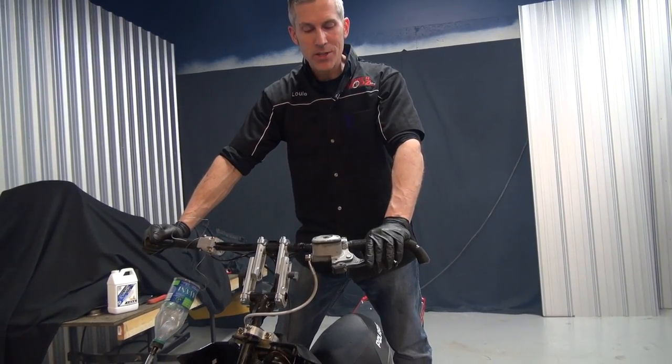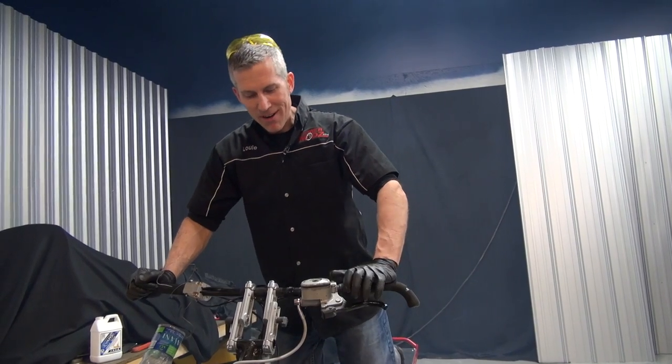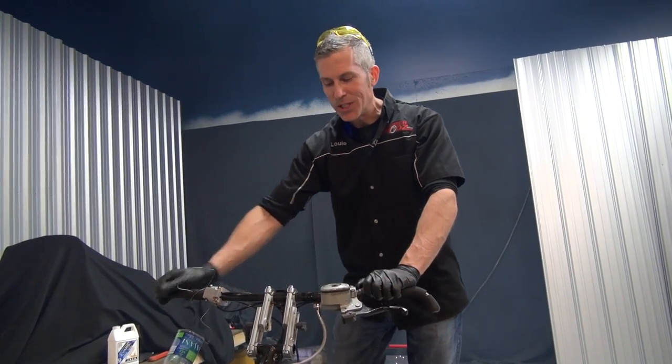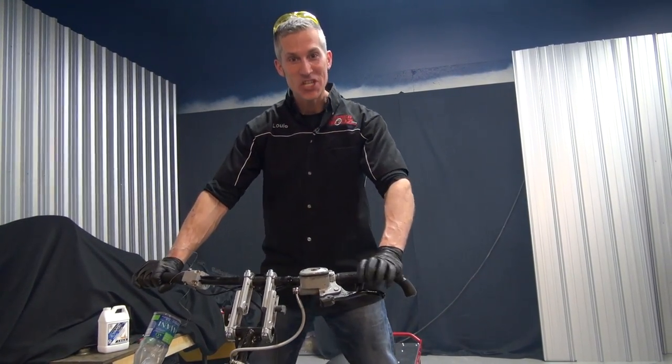Interesting — I was wondering why my kill switch wasn't working. When I had this all apart, I hooked the brake up to the kill switch and the kill switch up to the brake light. So I just pressed the brake and it shut off.